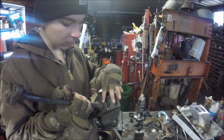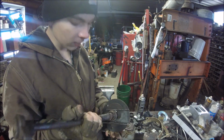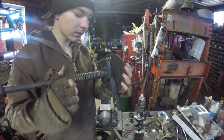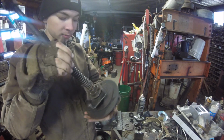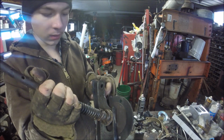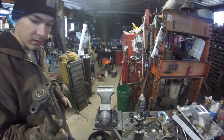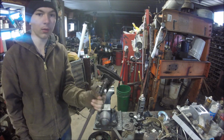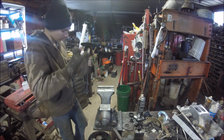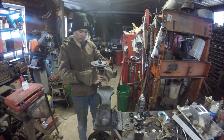You know, a bearing. That's what that's supposed to be. It might be a little hard to see, but yeah, there ain't no bearing left to it. With that not turning, it's grinding away at this here clutch fork. I don't know why the previous owners didn't just fix it. If this happens to you, fix it, and don't try to jerry rig it. I actually might have to put that in the press. That's what you guys are sitting on.